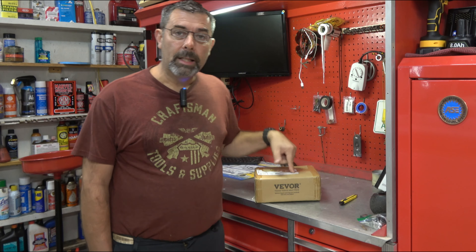Hey guys, it's Eric here at Farpoint Farms. Check it out — I got a bunch of older lead acid batteries that are just not holding a charge, not taking a charge is what I should say. There's a lot of changes that have happened in charger technology over the last few years. Used to be you got yourself a 10, sometimes 20 or 30 amp charger that was either 12 or 6 volt lead acid only, and these things would work as long as there was something in the battery to begin with.